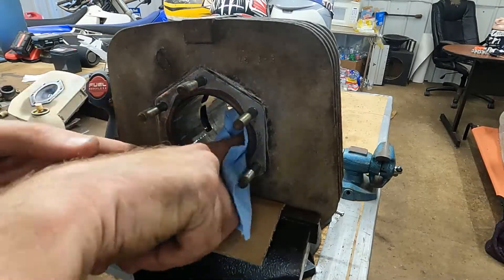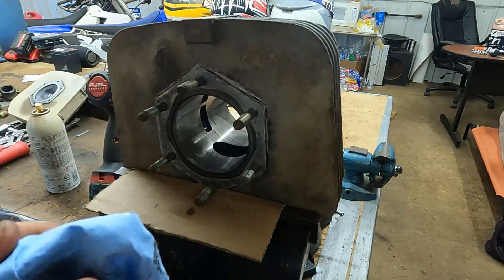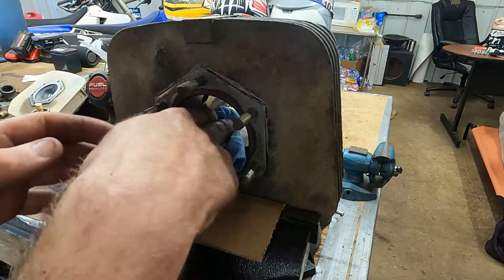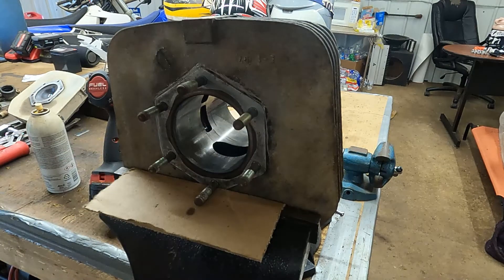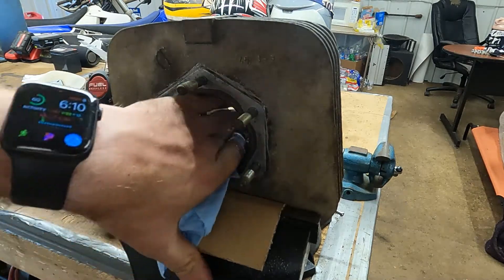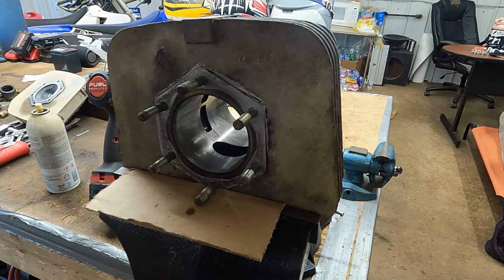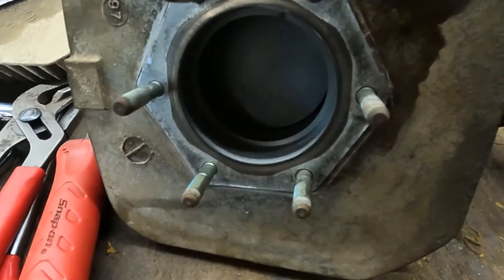I'm going to take a clean rag and kind of start to wipe some of that oil off and inspect how my crosshatches look. I'm not trying to get all of my marks out of the cylinder — I'm just trying to get the high spots knocked down and get some crosshatching in there so that the rings will seat. The whole point of the crosshatching is that it holds microscopic little beads of oil in the crosses of the hone, which helps hold oil in there for lubrication on the rings. If it's too smooth you won't get any lubrication on your rings and you'll wear your rings out faster. I sprayed the cylinder out with carburetor cleaner to get it good and clean.